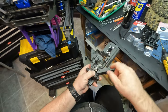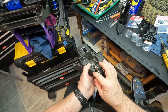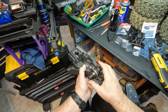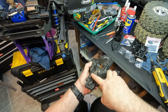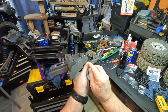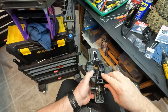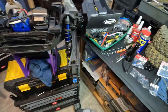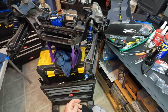This particular setup has no slack — I love that. What you're trying to do is just get your ring closer to your pinion gear. The other way to do it: take off your drive cup, slide that off, and take one of these shims starting from the smallest, put it against your bearing, and when you install it there's a little lip right there — make sure you get the shim on the inside of that lip when you slide it back in. Make sure it's good and tight and check to make sure you'll see that shim tucked in underneath. I'm meticulous — I go a little bit at a time, incrementally, until I find exactly what's going to work best.